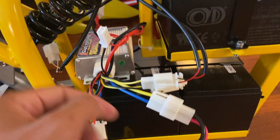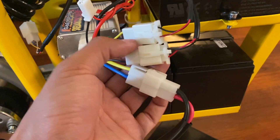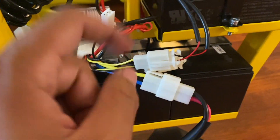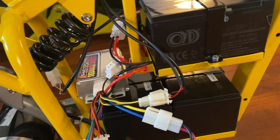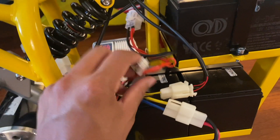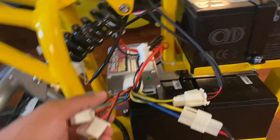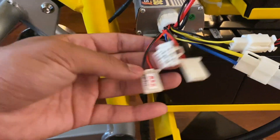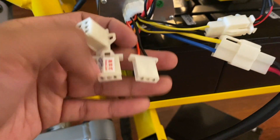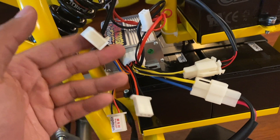So far the kit's been very plug and play. The motor plug plugged right in, and even the two brake lever safety connectors actually plugged right in - which I'm going to eliminate at some point when I do hydro brakes later on. The power source and the charge port I'm going to loop over to the other side - we'll find out if some modification has to be done there. A lot of these - the headlight and tail lamp ones - are optional. And then this five pin one is going to go to the new throttle, which we're going to install now.